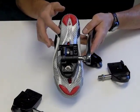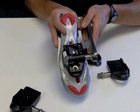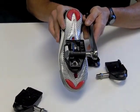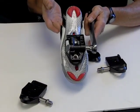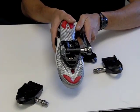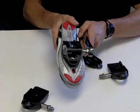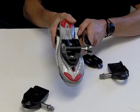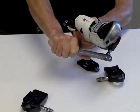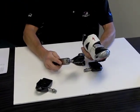Also, this float is not re-centering float. With a lot of other pedals out there that have a spring-loaded catch mechanism, when you float off, the spring pushes you back towards center. With these, wherever you wind up in the float range, it just stays there — there's no re-centering force generated at all. So it's a very solid connection and a very secure-feeling float. To snap out, it's just like any other pedal: you just tilt the heel out and you come out.